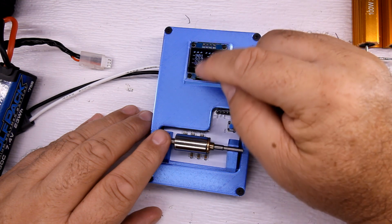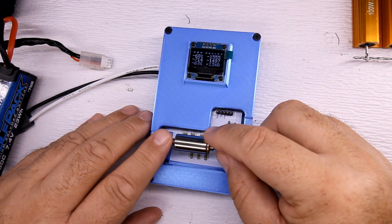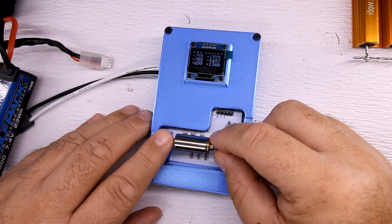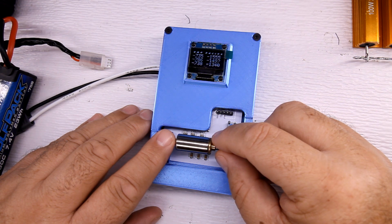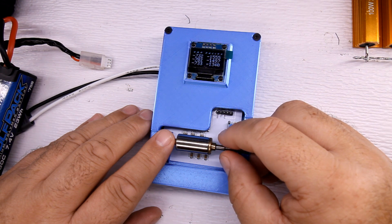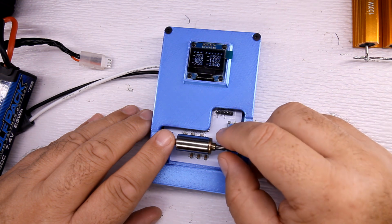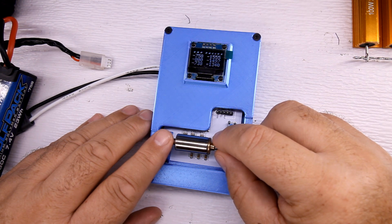You want the top number and the bottom number to be basically within like 50 to 75 points of each other. They don't have to be exact, because, well, I'll show you here. So let's say right about there is pretty much exact. 734 and 740 when I was jumping all over the place. But anyways, it's exact. Now, watch the middle number as I move this to the sides.